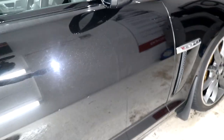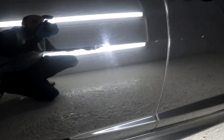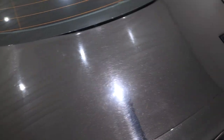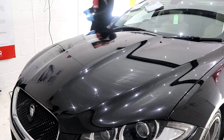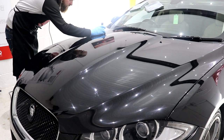The Jag is in for a two-stage minor paint correction detail, G-Technic Crystal Serum Black treatment, wheels off and ceramic coat, window coating, plus a tickle around on the interior. Like most detailing jobs I am restricted to working to the customer's budget, as the sky really is the limit with detailing, but nevertheless I still have four solid days to get the Jag looking as good as it can. The first step was to wash and decontaminate the Jag before measuring the depth of the paintwork to begin sussing out any potential respray panels and to begin forming a plan of action.